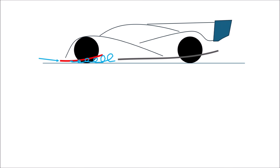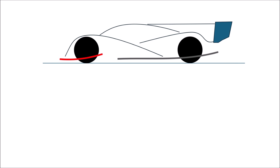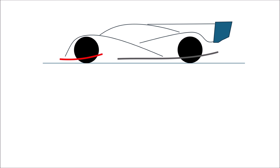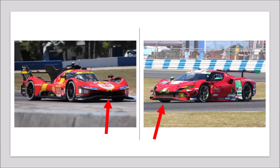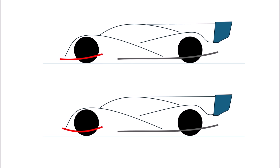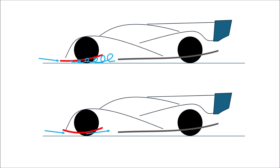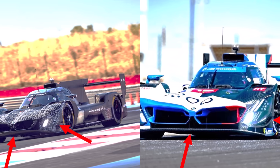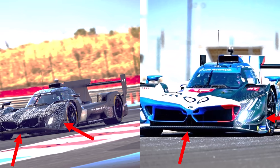This could be what BMW meant with more constant airflow. Their low splitter could have come too close to the surface under braking, which could have choked the flow to the back and even created separations at the front diffuser, which affects everything downstream. We can see a very high Ferrari-style splitter at the front, pushing lots of air underneath the car and making sure to still have a big enough gap under braking, which should provide more stability in braking zones and make the car more drivable. And because they might generate more stable downforce with the front diffuser now, they don't need canards anymore.